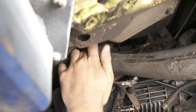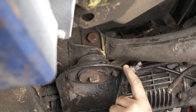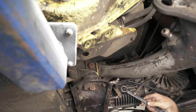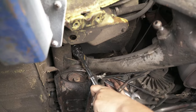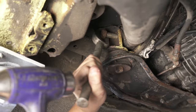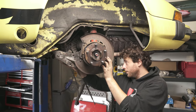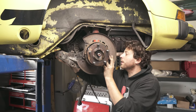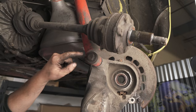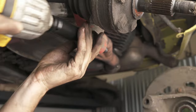Now we're going to remove the bolt up here that holds on the top of the trailing arm because we're going to replace the trailing arm bushing up there. Sneak in with a 19mm wrench on the back to hold the nut and use a socket wrench on the front. Got the nut off the back — now we just need to pull that bolt out. I like to employ my old friend the pickle fork. Now we're going to pull the trailing arm out of its place in the subframe and swing it down. All we have to do is remove this bolt and that will separate the strut from the trailing arm.